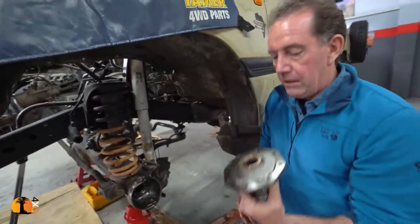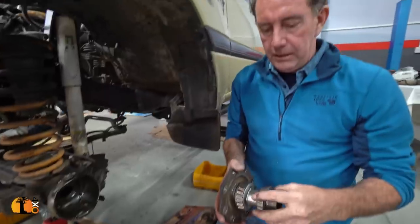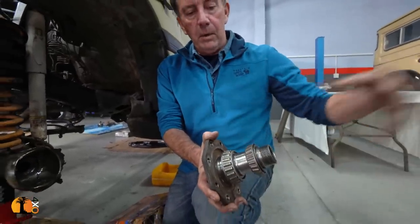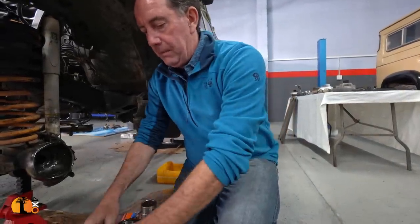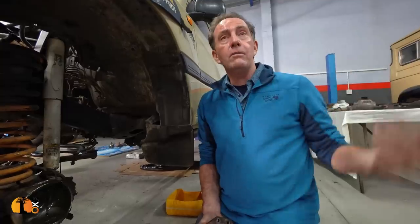From here, to make the wheel turn, we've got a spindle. What I want to show you is the bearings — here we've got the spindle, and these are the two bearings where the actual hub, where we bolt the wheel, runs on it. The critical points here are to check the bearings. People don't do this often enough. When you're driving on expedition, you've got a really heavy vehicle loaded to heavy capacity, you're putting a lot of load on the wheel bearings. That's why a Toyota factory service regime is slightly different to an overland service regime — you're putting more stress on components like bearings while driving some really harsh roads.